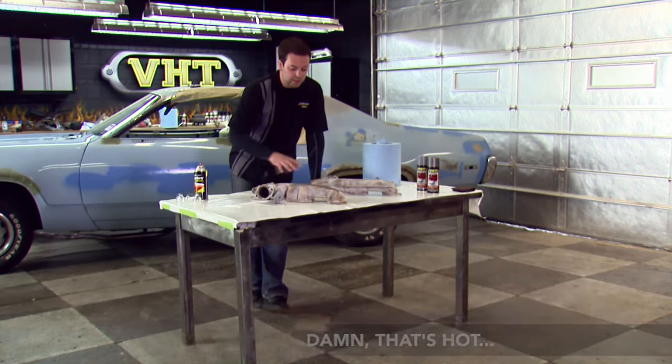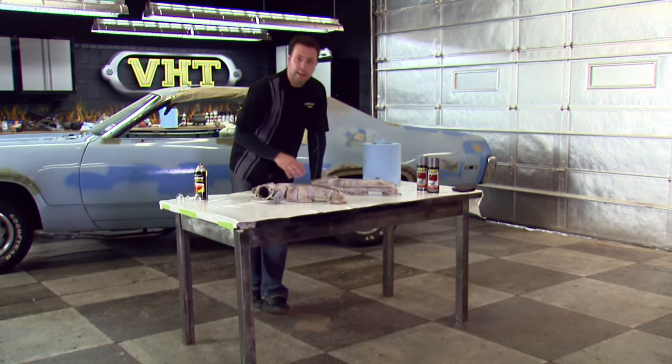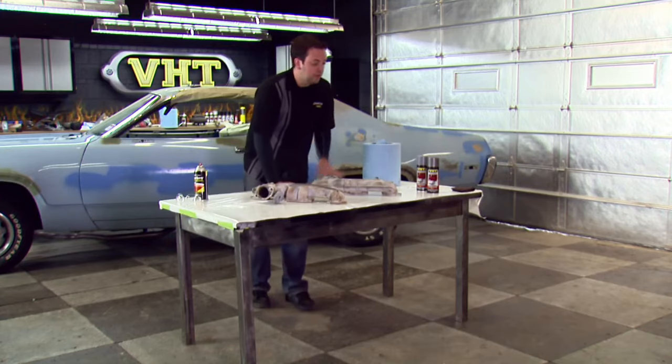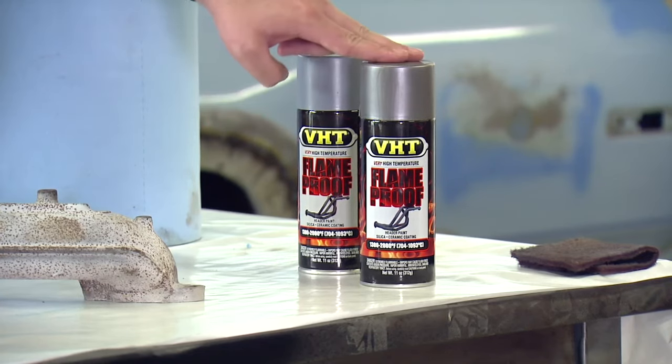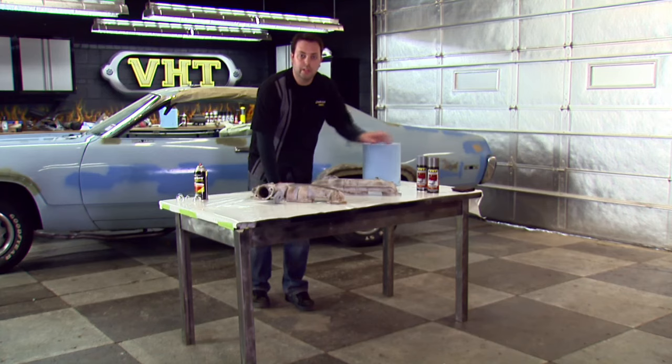What we're going to do is give it a light scuff with our wire brush, then come back and prep spray it to get all the loose rust off and get it as smooth as possible. That'll allow for a nice, even coat of paint. Then we'll use our VHT flame proof gray primer, and for the top coat we're going to use VHT's NuCast cast iron, which will help it look a little bit different than our yellow engine that we painted.